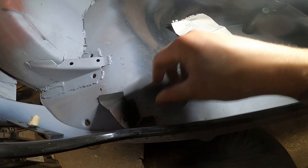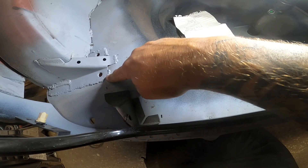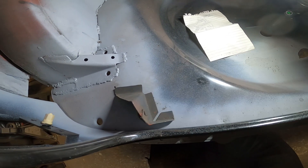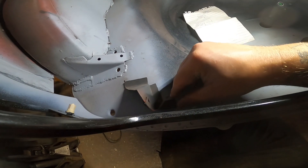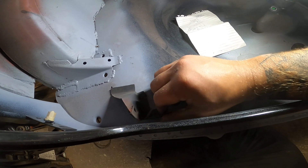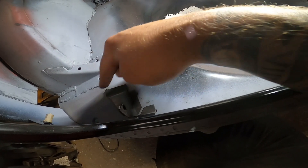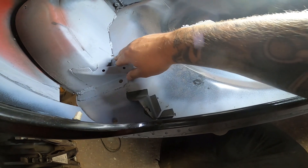Here we are in the back of the car again. I made some notes basically years and years ago when I took this car apart — measuring from here, edge of the subframe mount from the side of the car, which equates to basically that. Just looking at the side, there's enough room down here for a wiring loom to pass through. And then that sits basically like that — it's a bit of an odd little bracket really, but all it does is hold the strap in for the fuel tank, keeps it nice and secure. I'm just going to run a stitch and get it in — a bit like I've done with there. I've not plug welded that, it's all been completely seam welded because it's a subframe mount. I feel like it's belt and braces, get it nice.